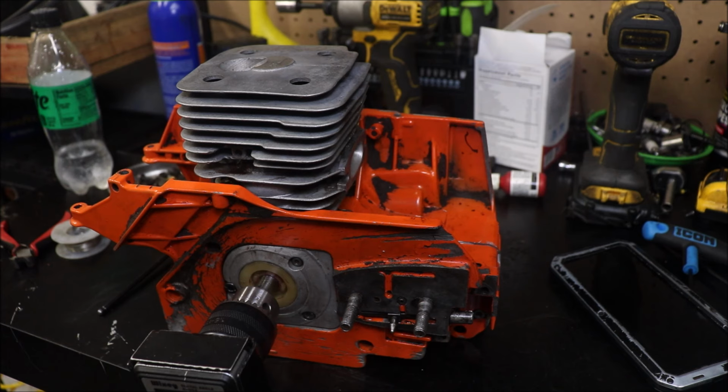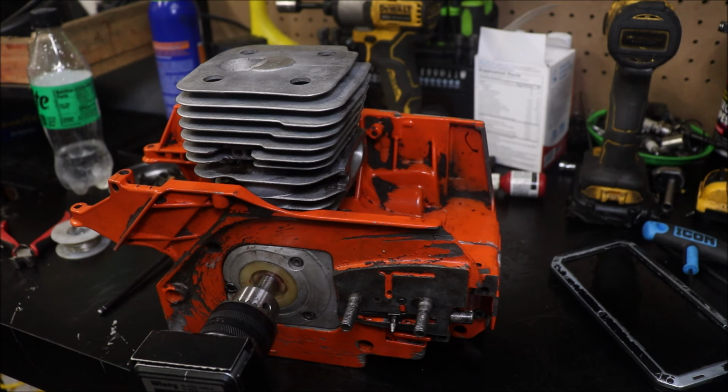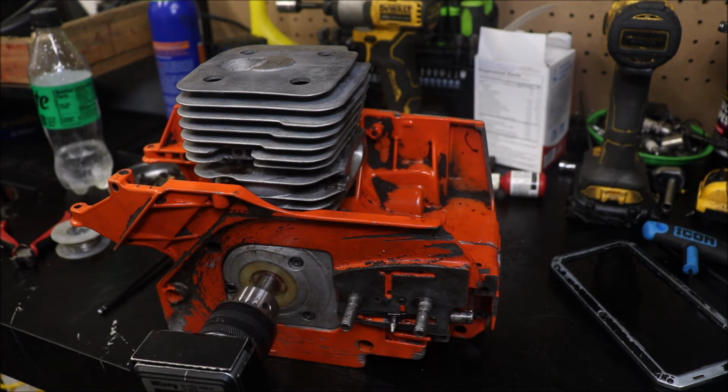But final numbers on it, once it's said and done and glued down, squish should be right on 25 thou. We've got 24 now with nothing. 104 on the exhaust roof. It should have a really nice thump. Should have killer compression. Should pull whatever bar he wants to put on it, with reason, I guess. 122 on the uppers. I kind of wanted to stick with that short blowdown that it had from the get-go.